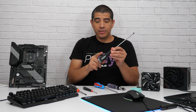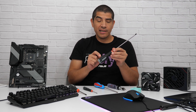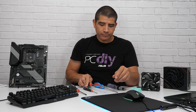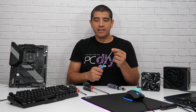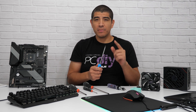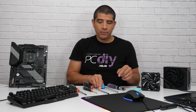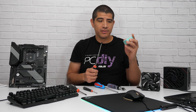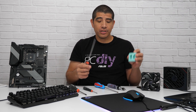One other thing to keep in mind is the handle. I'd generally recommend not having a full polymer plastic-based handle, as they tend to be harder to hold and more slippery. Regarding tips, many users prefer a magnetic tip, which is perfectly fine. But keep in mind that magnetic tips can wear out over time, especially under heat or direct sunlight. If you already have a screwdriver you like, just get yourself a low-cost magnetizer, which will allow you to magnetize any tip for any screwdriver.